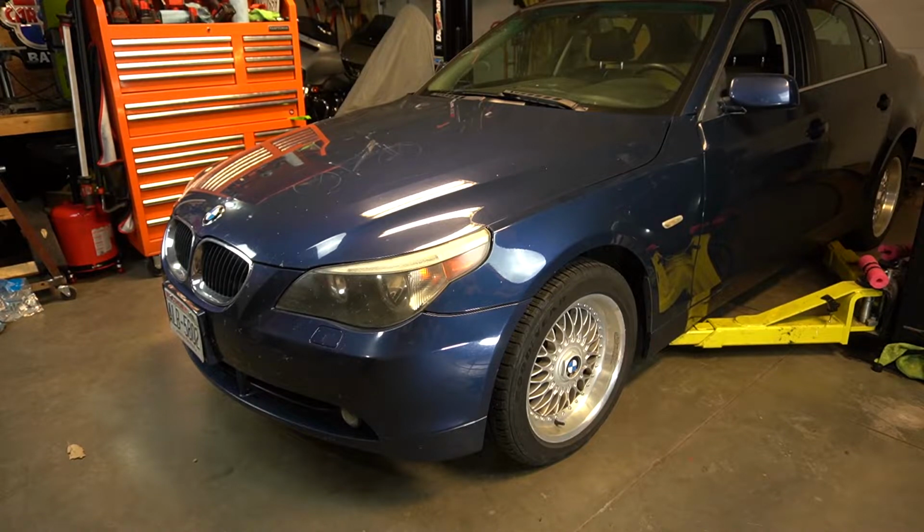Alright, so we have the valve cover gasket replaced. Everything's been bolted down correctly. Remember to torque that valve cover at 10 Newton meters. Additionally, I checked the oil just to make sure we're at a good level. It's all set. I'm going to get the car out of the garage.